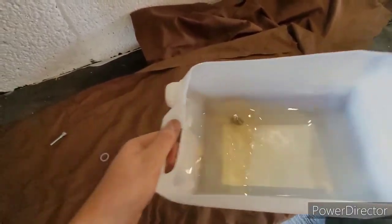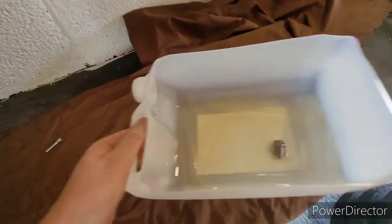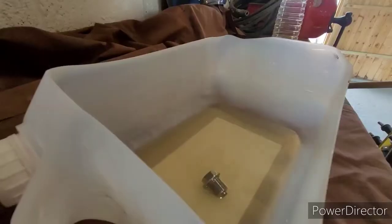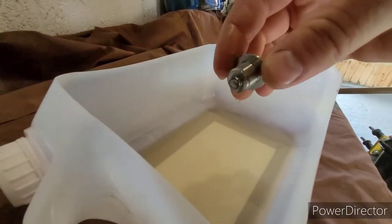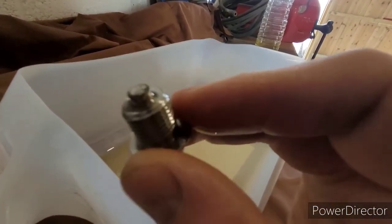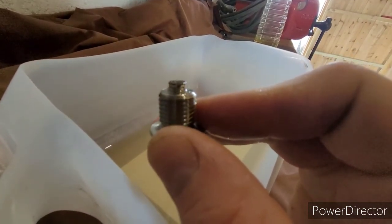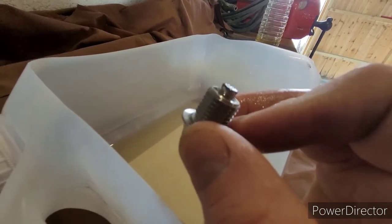So we'll mimic what the engine's doing running in — say a thousand miles. I'll swirl that for a couple of minutes and then pull the plug out. So the engine is running, we're draining the oil. There we go — see all the metal filings now stuck to our magnet.